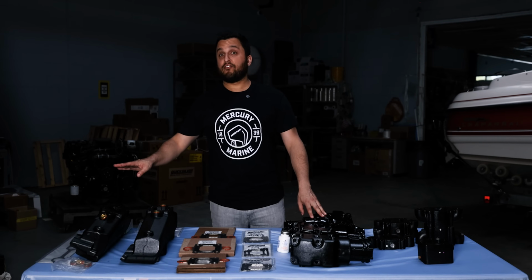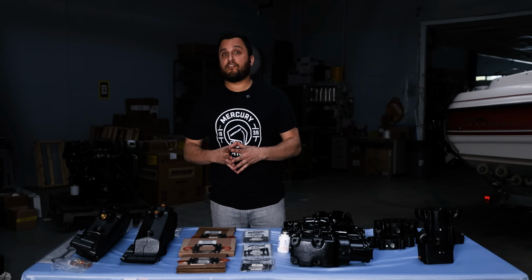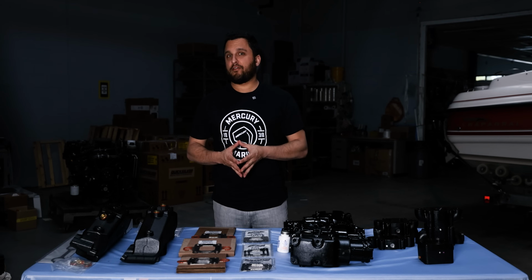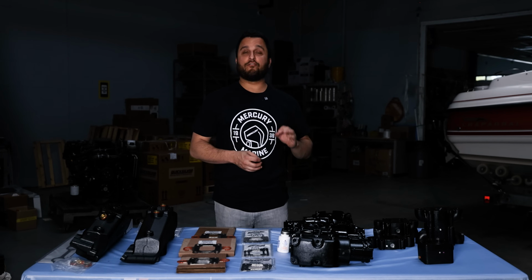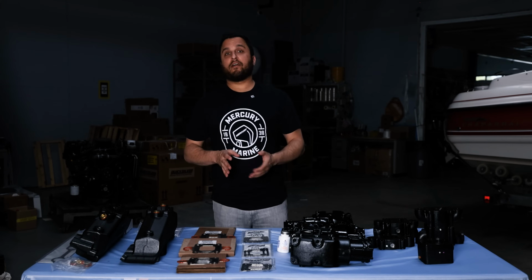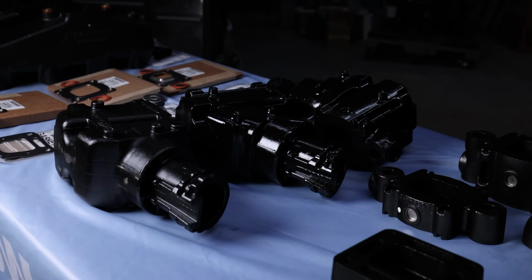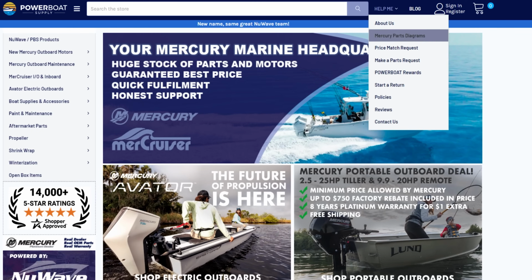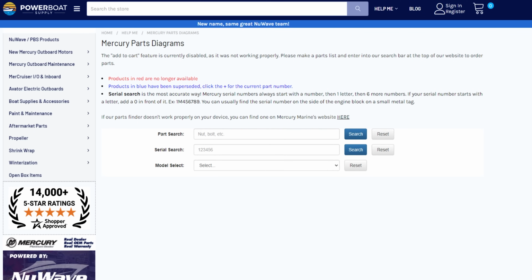If you have a dry joint engine, the next thing to figure out is if you have a 7 or 14 degree elbow. The 7-degree elbow was on the earlier dry joint engines from about 2002 to 2004, and 2004 and later, they moved to a slightly taller 14-degree elbow. The easiest way to figure out which elbow, or if you have dry joint at all, is to use our serial number lookup tool or give us a call and we will do it for you.